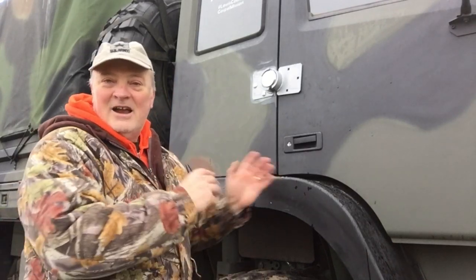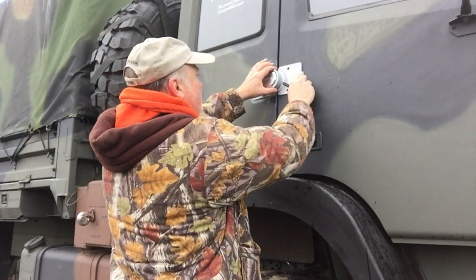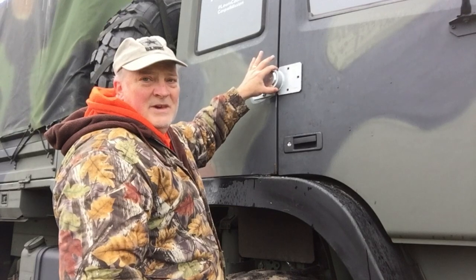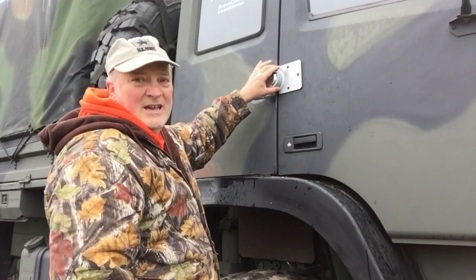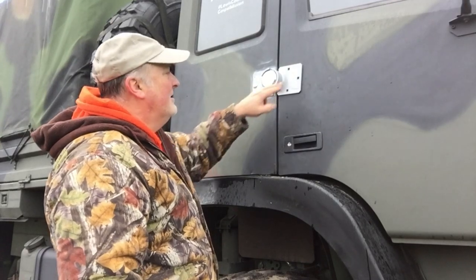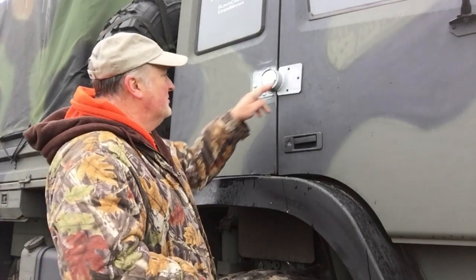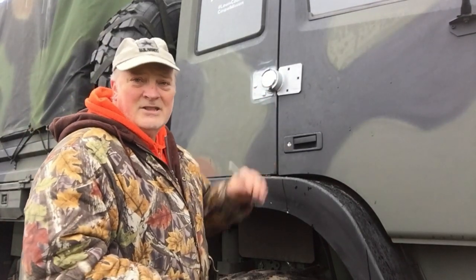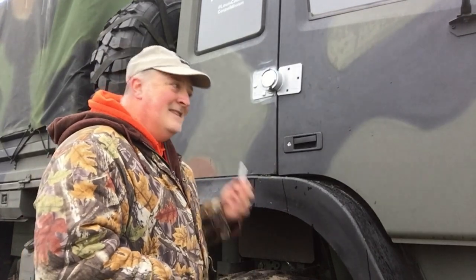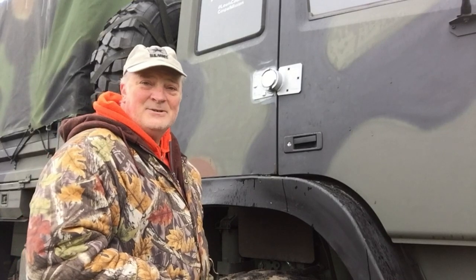All right, now I'm gonna put this on the door side. So I got the lock on there and I'm just gonna kind of center it where it wants to go in the middle here with all the play. And make sure it's aligned with this plate here, and then mark the holes, drill it, and it'll be the same procedure, putting the Vulcom on there, running the bolts through, tightening everything down, of course putting the washers on the back, and this side will be done other than painting, and then I just have the other side. So stay tuned.